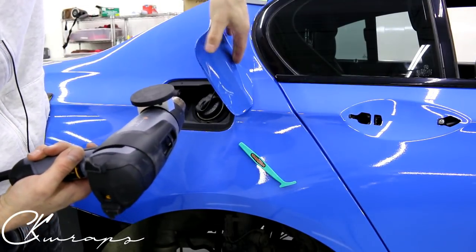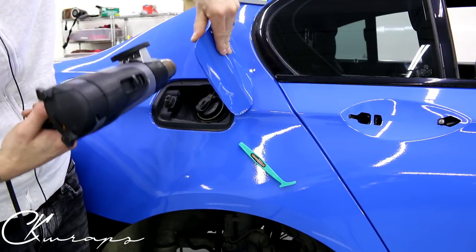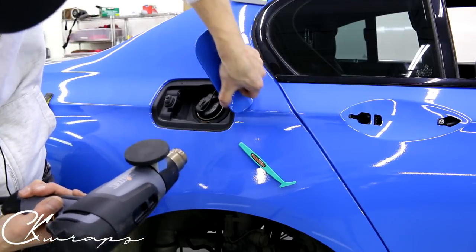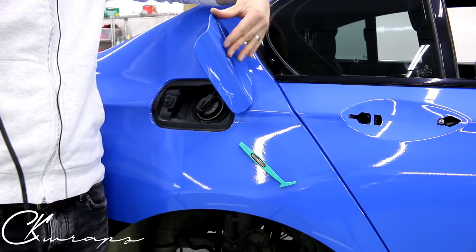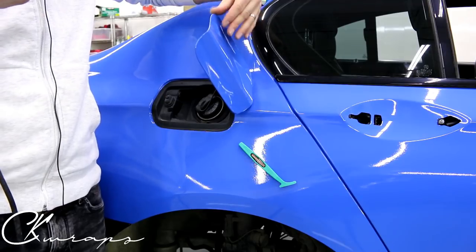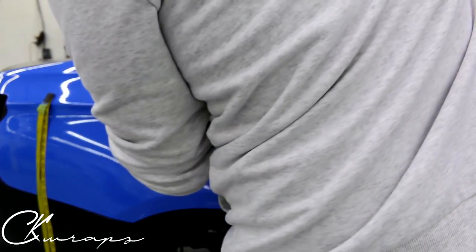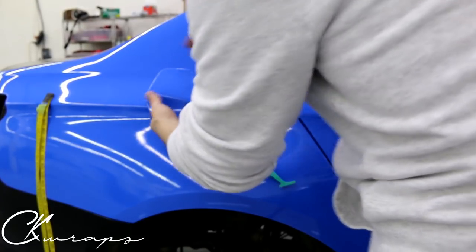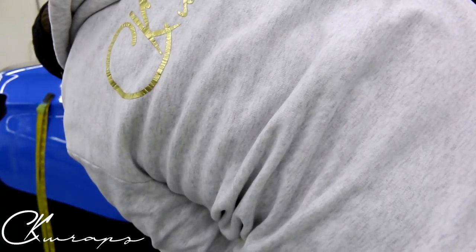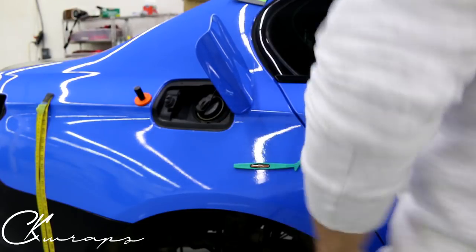For the rest of it you want to work the film around little by little, adding heat. You probably want to use a wrap glove so your fingers don't stick — when it comes to gloss films your fingers will stick slightly more. I'm going to do the same thing and prop this open so that I have good access. It folded itself over before I got to it, let's fix that up.